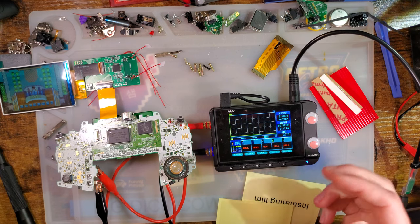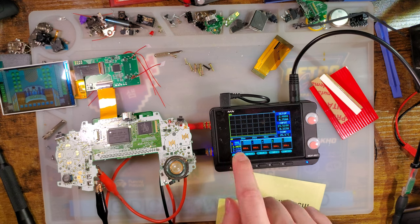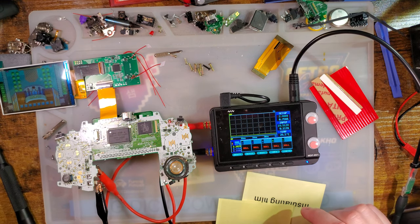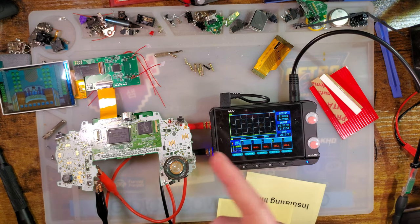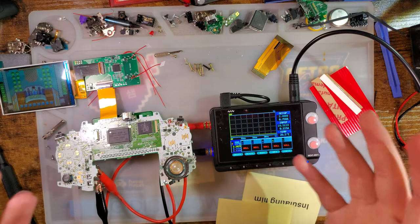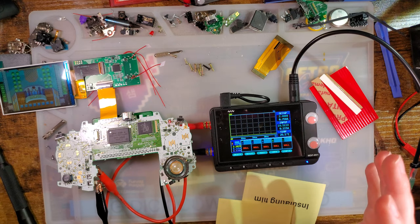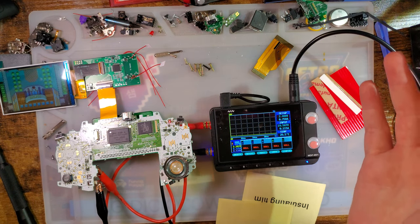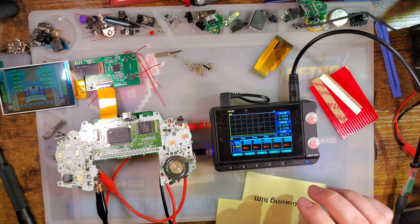Sounds about right. So on low brightness, we're pulling at 2.4 volts, anywhere from 224 to 230 milliamps, which, again, that's pretty on par. I believe it was 94 that it was pulling before this, so you could do the math on that. It's not exactly linear, but it's still going to be about 45% battery life, so if you were getting 20 hours, you'll get 9 plus or minus.